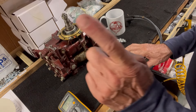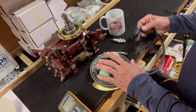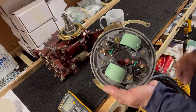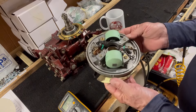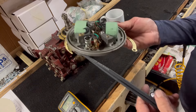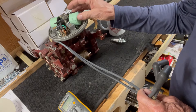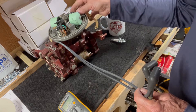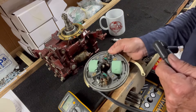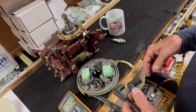Here's a T-Mic trick for the ultimate testing of your wiring on your ignition magneto. I sell rebuilt ignition magnetos for all Johnson and Evinrude 3 horsepower to 25 horsepower. I completely rebuild them with new coils, points and condensers, new wiring, new spark plug boot wiring. I set it on my test motor, set the points, clean them, and set them to the right 20 thousandths gap. But how do you do the complete wiring check after you're all done? I'm going to show you a trick that I haven't seen anybody else use.